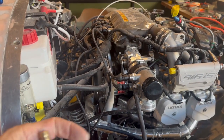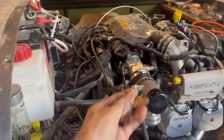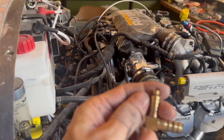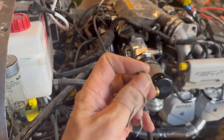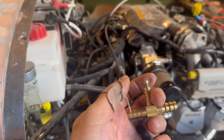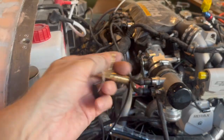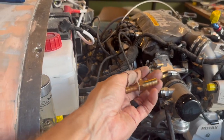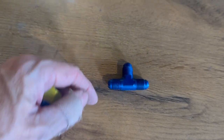We were unfortunate enough to be tied up with the counterfeit Continental fuel hose, so we're having to redo that. One of the things is this jetted T-piece that was sitting in here - that's the jet there, and it's just been threaded into the T-piece with a quarter-28 thread, so that's pretty easy to deal with. In place of that, I intend on going through to Teflon lines - we can get all the parts locally, but I just have to make the jetted T-piece. A standard AN6 T is one part of the equation.